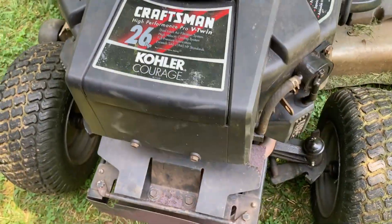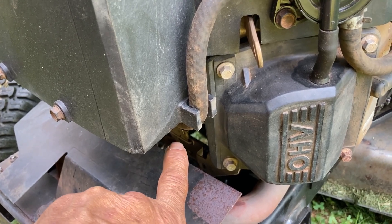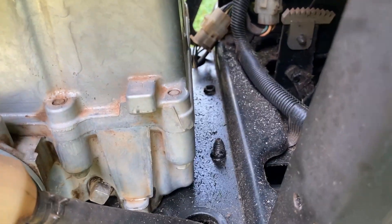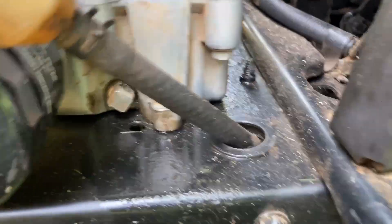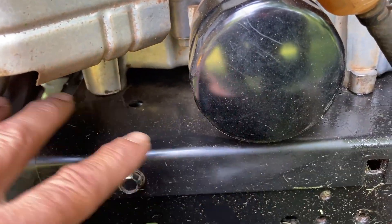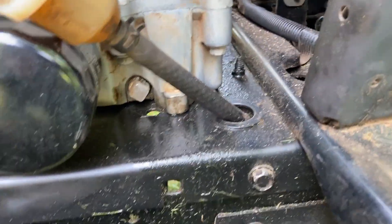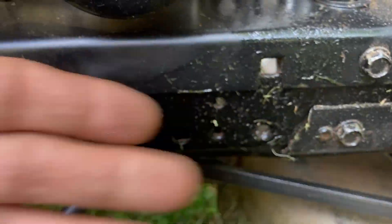Coming back here to my engine, I still have a small oil leak in the front on my oil pan seal. That pressurization has just broken the seal — it's never going to reseal again. And after two hours of driving, I still have a pretty decent crankshaft oil seal leak. So I still have more work to do, but prior to fixing that hose and resealing that cap, this entire frame would have been completely soaked with oil — dripping off everywhere, belts soaked, everything.